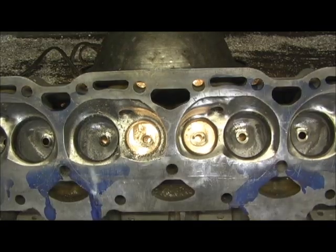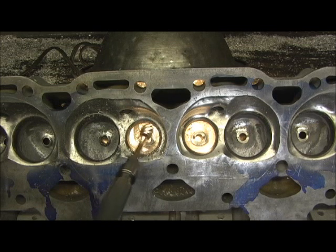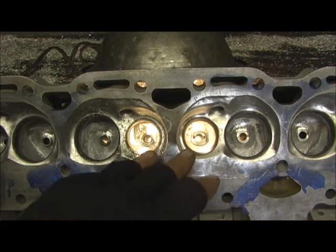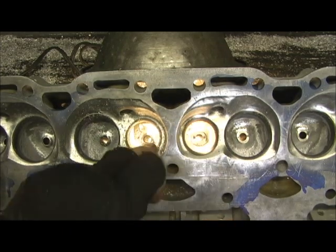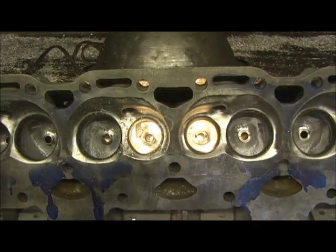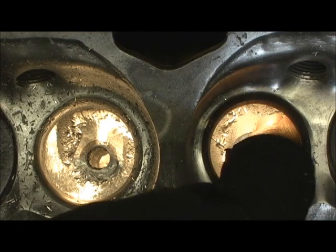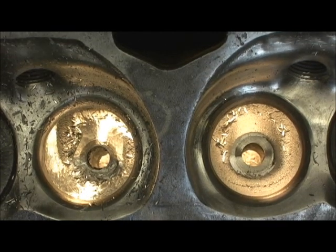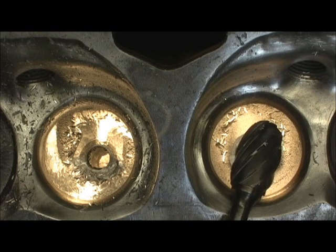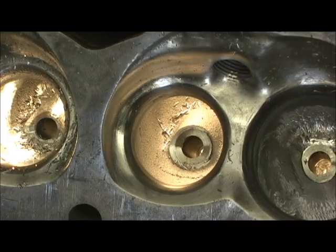While I've got my big aluminum chomper, the Hogmaster, grinding it out, I wanted to show you this is one that's almost finished — it does have some trimming to do. But the point is, on the exhaust, air is exiting, and this big block is going to cause a tremendous amount of turbulence. If we go in there, round it, and pull that out like I did in this one, it's going to make quite a substantial difference on roof flow. Look how big and bulky that is versus how streamlined and rolled this one is. Since that area is in the roof especially, it's critical.